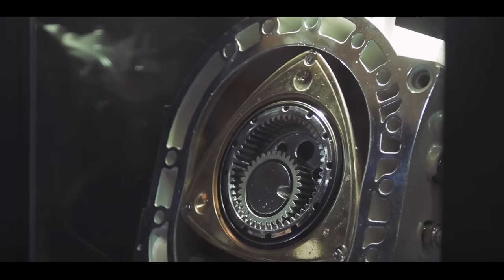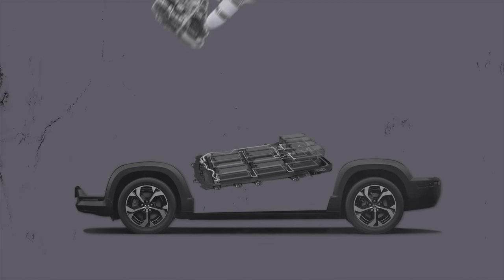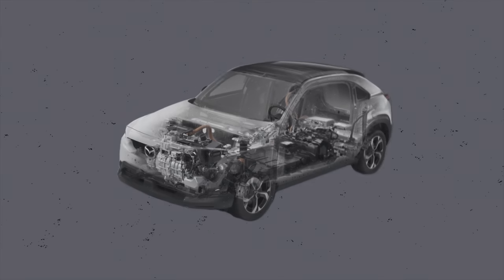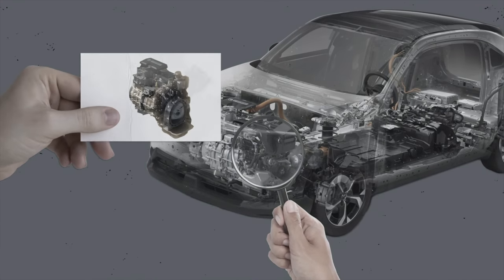There's been a lot of hype about Mazda's plans to add a rotary engine to the MX-30, but it's just a compact rotary engine that doesn't even power the car — it's a range extender that powers a charger to add more battery capacity, like a generator. Some consumers are calling it a marketing gimmick. Essentially, Mazda took the EV and added a rotary combustion engine, turning it into a plug-in hybrid (PHEV). Inside the Mazda MX-30 eSkyactiv REV you'll find a 17.8 kWh lithium-ion battery, a 160 PS electric motor, and a new 830 CC single-rotor 70 PS Wankel rotary engine.